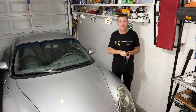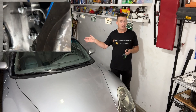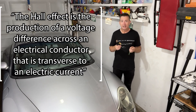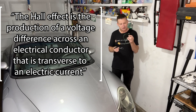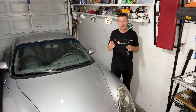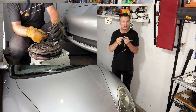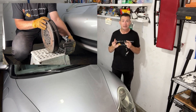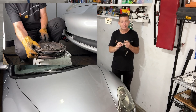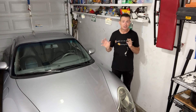Let's take a look on the car where this is. It's right behind the driver's wheel, right on the join of where the engine meets the bell housing on the driver's side. The crankshaft sensor is a hall effect sensor, like a proximity sensor — it can tell when metal is nearby. We'll do a little static demonstration in that position near the bell housing. It's got its sensory part facing towards the teeth of the dual mass flywheel, and where that gap in the flywheel is, it can tell every time that goes by — and all those little teeth too.